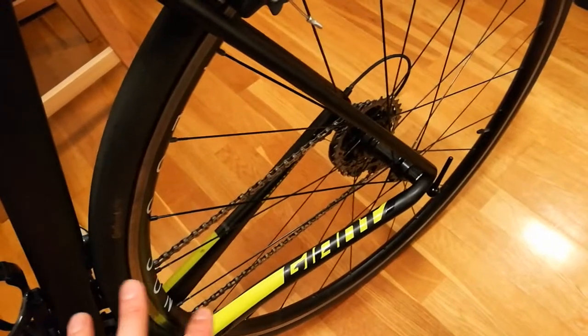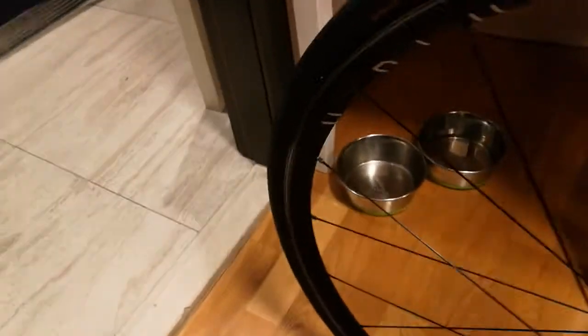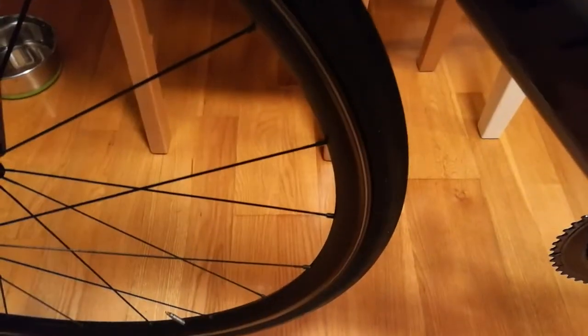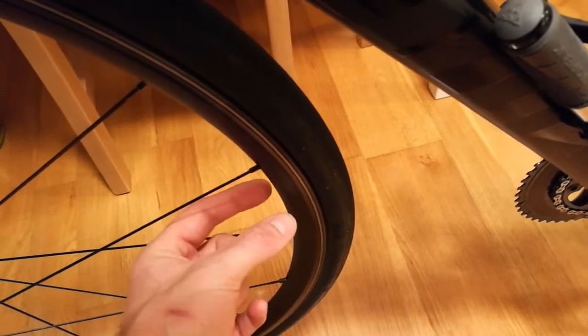So it doesn't really matter what nice aerofoil shape you've got going on with the rear wheel here. You kind of need a better profile here, and this is a reverse teardrop, so it's okay if you've got 0 yaw, but any sort of apparent wind that way or that way, it's not a great shape for drag. Again with the front wheel. Now you've got at this end the proper teardrop aerofoil shape, which isn't bad, but then a reverse teardrop there, which isn't very good. Which is now why you're seeing wheels with a wider U shape here.